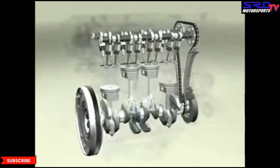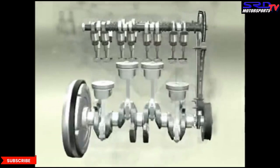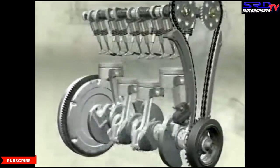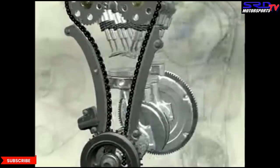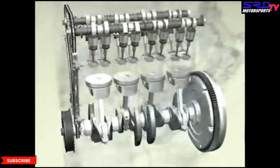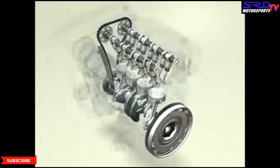The higher RPM you go, the harder it is for the air to move. As pistons two and three push down on the power stroke, the air beneath is pushed out into one and four — which is fine. But as one and four pull down, it pushes back to the same place. Anything above 5,000 RPM this is just too abrupt. With oil spray in there, it's like a fog of oil — that is part of the windage loss. The engine makes power, but it has to fight through all that load, and that power is hidden. On turbo it's a lot worse because the acceleration rate is very fast.